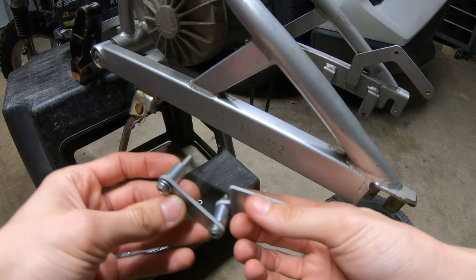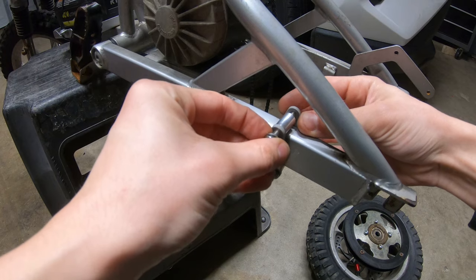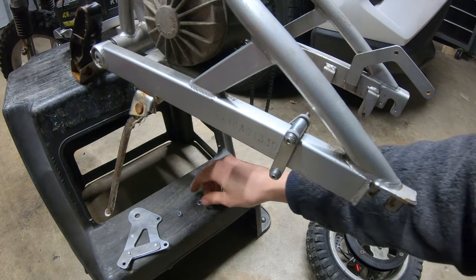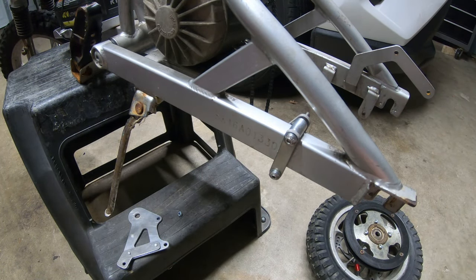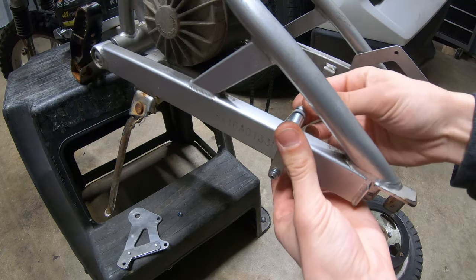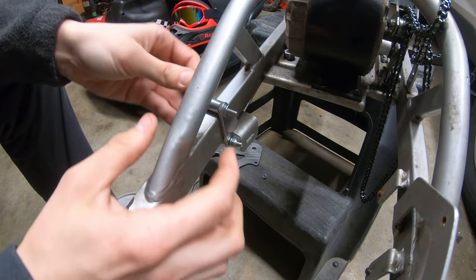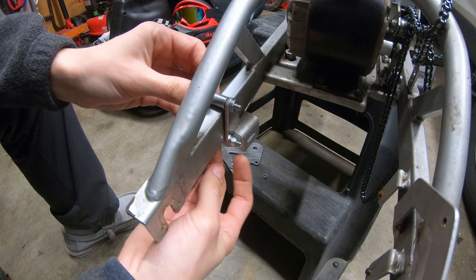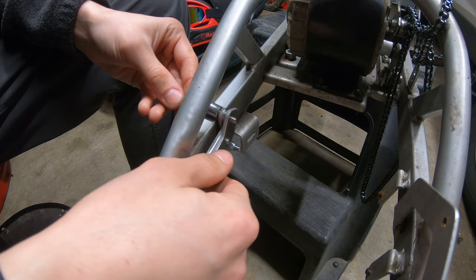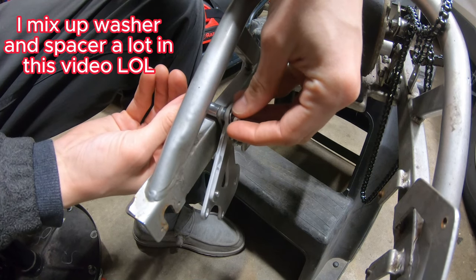So now you'll be able to swing this up, put your bolt through and put the nut on. Now that we have the first piece of our bracket, we're going to go ahead and slide it on here. Slide it down and flip it up. Go ahead and run our top bolt through. And then I am taking three of the included washers to put on the backside of the top bolt. I'll show you guys what that looks like. So we've got three washers here — this sits on the bottom piece here. Then we are going to slide on our caliper mount, just like that. And then we can put a spacer and nut on the bolt.